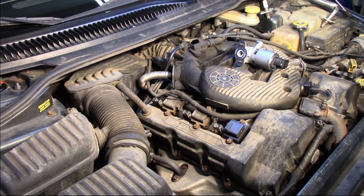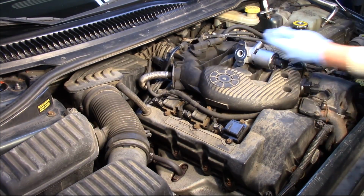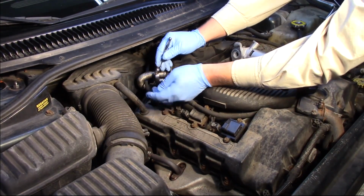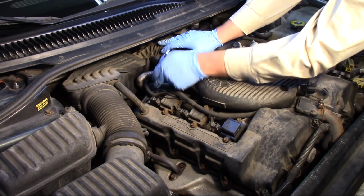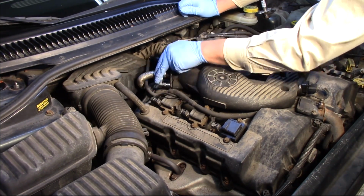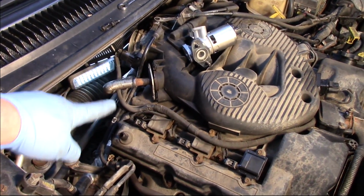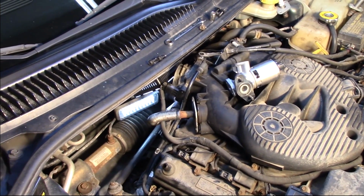But it's pretty straightforward. And so I'm going to use a couple ratchet end wrenches or a couple sockets here, and let's go ahead, break these loose, and work on these tubes here. And then I'll pull the air cleaner assembly off, and then that'll give us a lot better access to get down to the backside. All right, well, I've got the air cleaner out of the way, removed all the ductwork here. I've unbolted those tubes up at the top of the intake manifold.